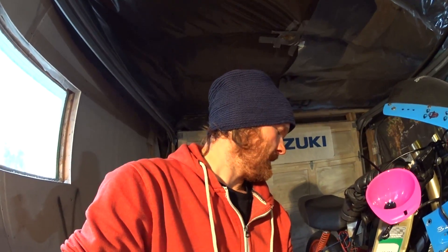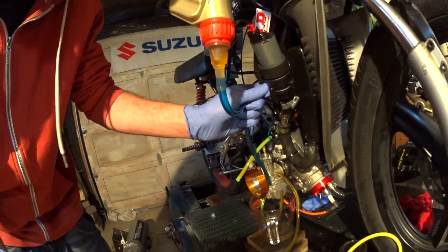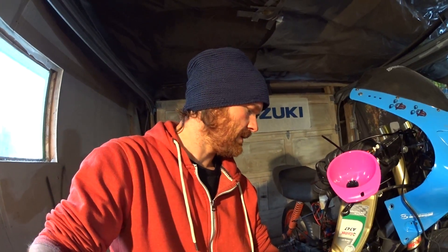So the modifications I did to the float valve basically put my numbers up to where they were without the float valve in the system — just the fuel line, not the carb. So now I'm going to try with this setup: just a makeshift fuel tank and a larger inner diameter hose, and see if this improved flow can further improve the flow through the float valve, or if the float valve is just too restrictive to get it much better.